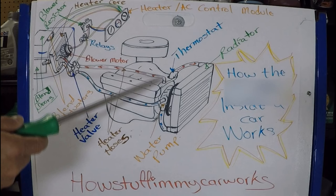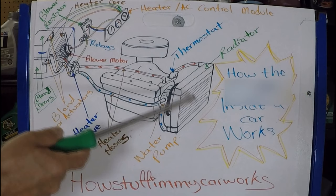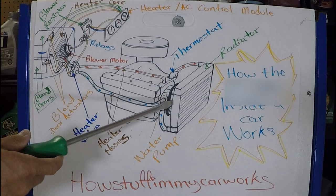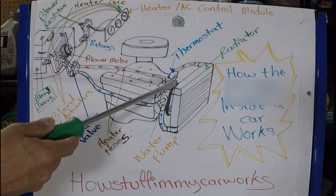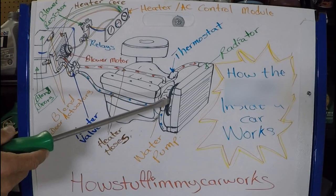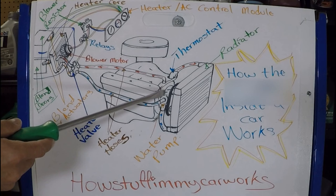As the temperature reaches 195 degrees, the coolant starts flowing to the radiator and the colder air passing through it is going to cool it down and it's going to come back into the engine. The part responsible for the flow is the water pump. Water pumps tend to be belt driven. This is an external water pump right here that you're seeing, driven by a serpentine belt that is linked to the crankshaft, alternator, air conditioning, and so on. Some smaller engines have the water pump inside the timing cover, driven by the timing belt or timing chain. So if you don't see a water pump on your vehicle, you have an internal water pump — they all have to have one.